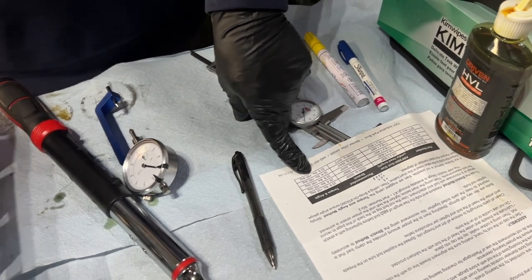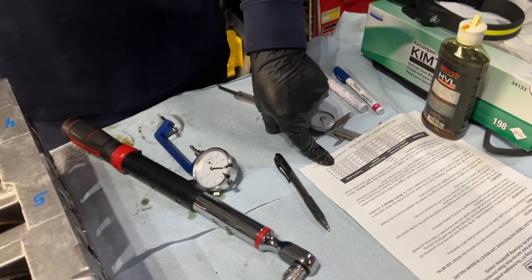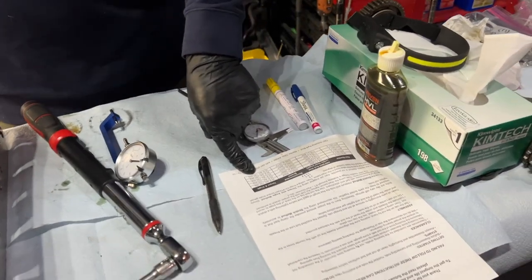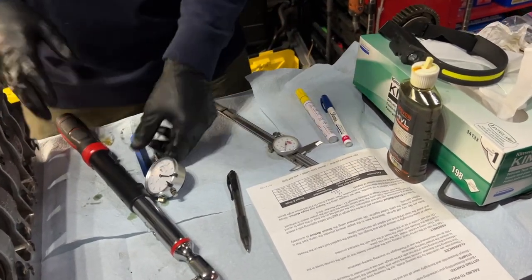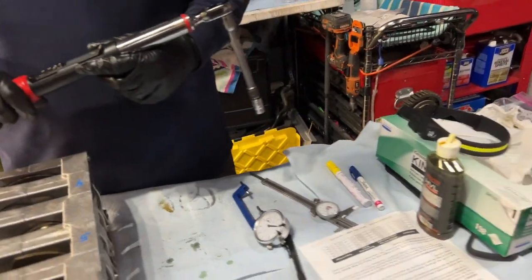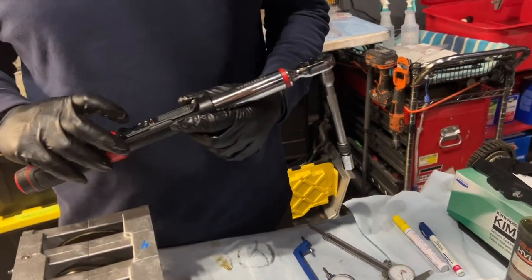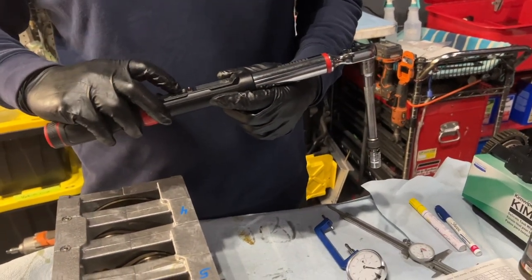So I'm wondering if we're going to hit that stretch, if we should go with 60 degrees and then measure the stretch. Yeah, that's what I was thinking. Do one like it says, and because they also pointed out that these bolts are reusable, if it is too much stretch or too little, we can adjust.